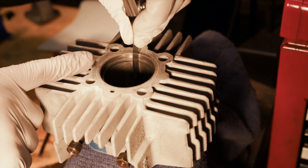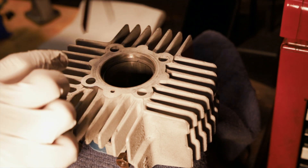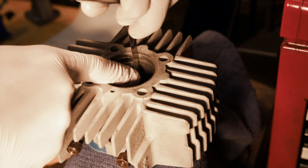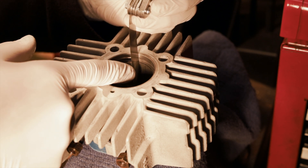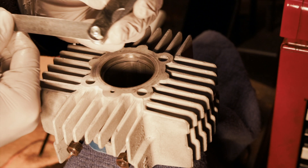0.13 fits in quite loosely so it's a little bit bigger than that. The next size up is 0.15 — that also fits the gap. 0.18 doesn't quite fit, so I need to make the piston ring gap just a little bit bigger to fit 0.18.